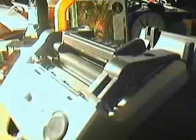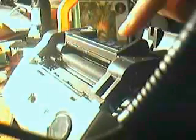Anyways, let me show you the inside of the printer. I've already taken mine apart. You're going to need a Phillips screwdriver to do this. Let me see if I can move the camera into a position where you'll be able to see this. And the microphone. All right, so here's the side of the printer. This is the part that we want to get at right here. Up in here is where the optical sensor normally lies, so you've got to take this off. There are 1, 2, 3, 4, 5, 7 screws. I've already taken this off because it is kind of fiddly, and it comes out.